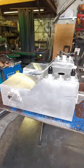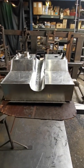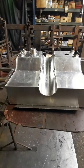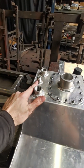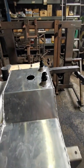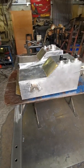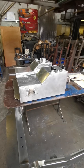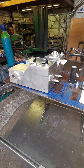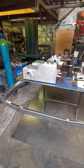Straight to the fuel rail. I hope you liked it — if you have any questions feel free to comment and I'll try to answer them. Before I go — that is the return from the fuel swirl pot, so if it overfills it goes back in here. This is a 6AN line coming back from the fuel pressure regulator after it's passed the engine and fuel rail. Thank you very much — I tried to keep it as short as possible but there's quite a bit of detail, I could probably talk for another half hour about how I got here. Thank you, bye!